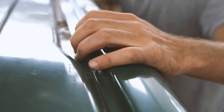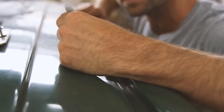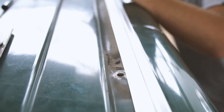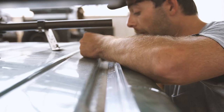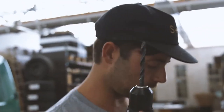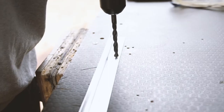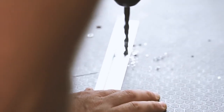You prop it up like that, about there. Got our sharpie and just draw a little line — there on that one — where we're going to drill a hole. And here we're going to mark another line in line with that hole. That's going to be a cut, so we're going to cut that and drill a hole there. Eight millimetres.